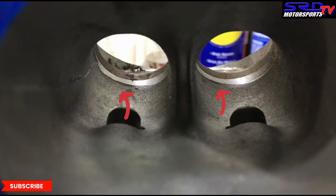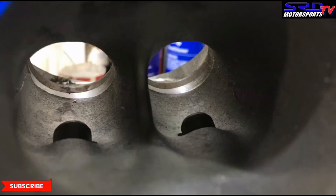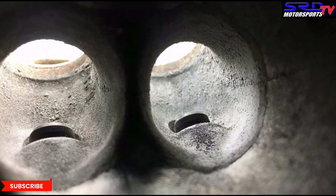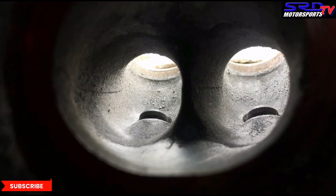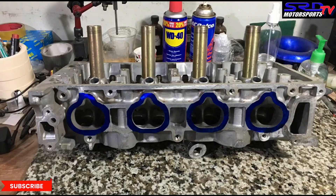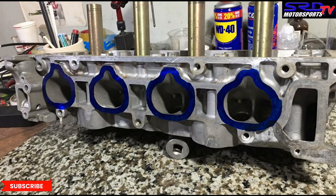The core shift is towards the left — it's making space there, but on the other side the port wall to the throat or the seat is consistent with no ledge. On the exhaust, the port seems to move a little bit backwards down to the bowl. If you decide to clean that up, you'll increase cross-sectional area — that's when you start losing torque and then requiring closer gear ratios, which becomes a never-ending cost.